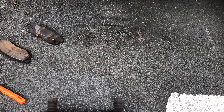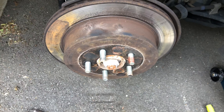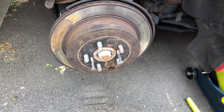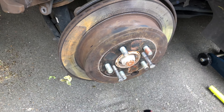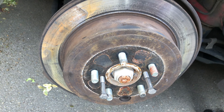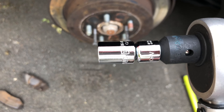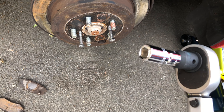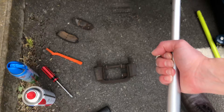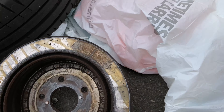The caliper carrier is off. These are the guide pins that need to be serviced and re-greased before reinstalling, and the brake hardware needs to be replaced as well. As expected, the disc is seized in place, so I'm going to try whacking it with the rubber mallet first, and if that doesn't work I'll thread in the M8 bolts to pull the disc off. Whacking with the rubber mallet didn't loosen it at all, so I used the M8 bolts to thread in and push it out. I had to go indoors to get a 13mm by 1/4-inch socket adapted up to 1/2-inch drive.